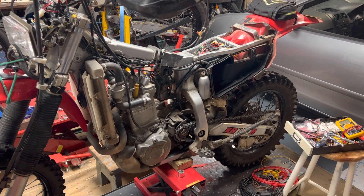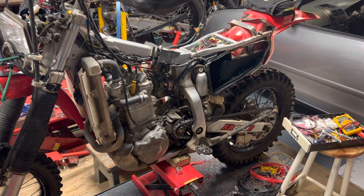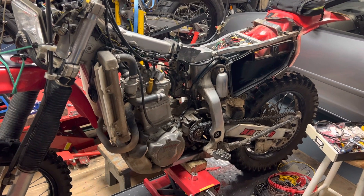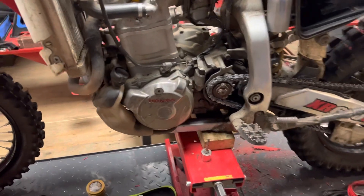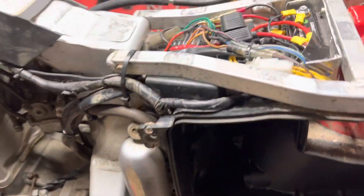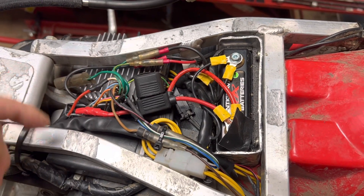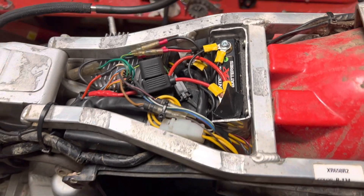This is my XR650R DC conversion, just finished late last night, 23rd of December 2022. It has taken a while and not been the easiest of things to find wires wise. We've placed the stator generator in there and managed to squeeze everything in under the seat — replacement regulator rectifier, the i-box, the battery, and all the associated wires.